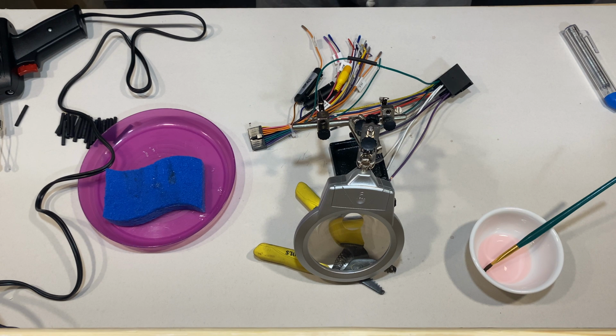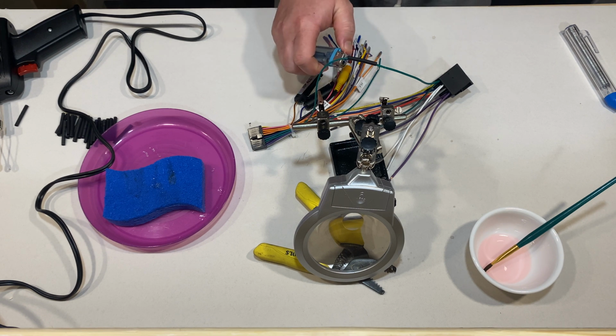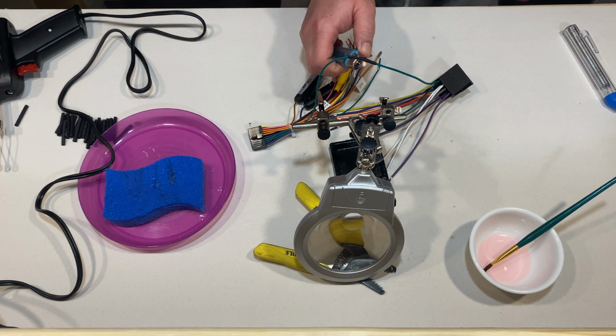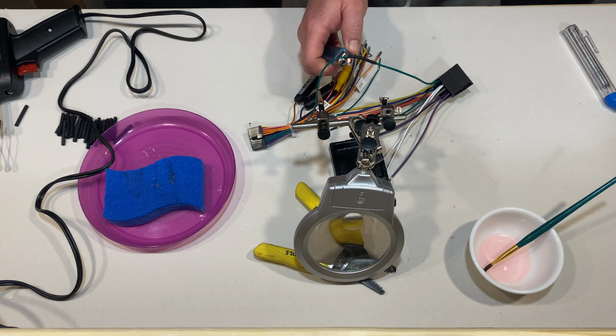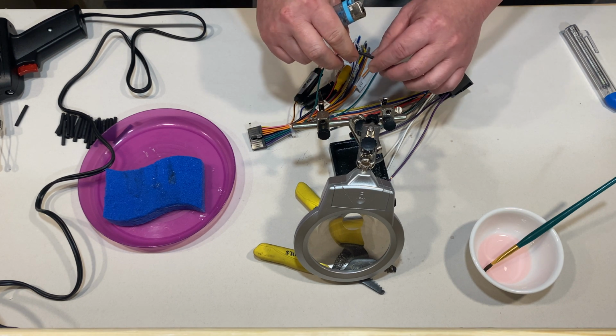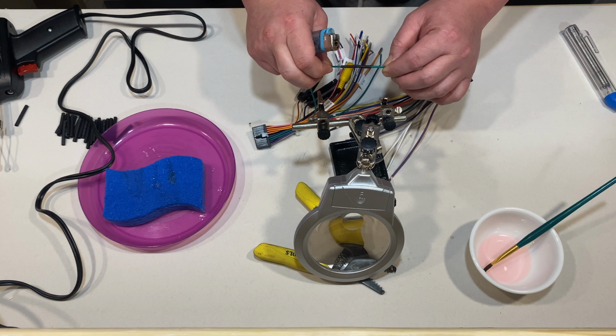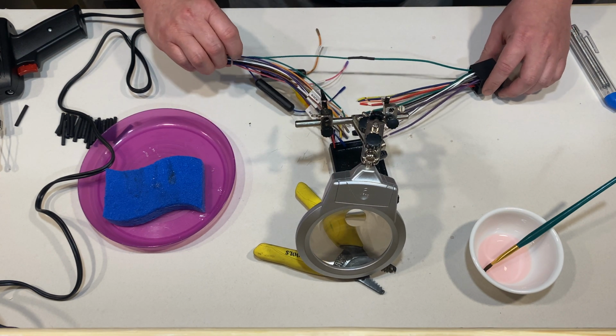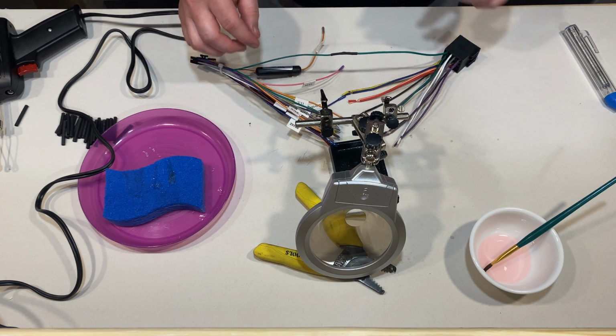So a little bit of an epic fail there. I guess my hair dryer wasn't hot enough, or didn't get hot quick enough. So your other alternative is a lighter. There you go. Just shrink it down. Nice and close, but not too close. And it should shrink it down like that. And nice, perfect connection. So now all you have to do is do the remainder of the speaker wires, and then we'll move on from there.